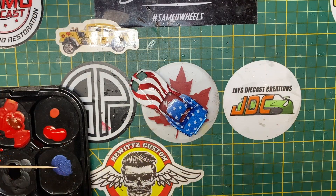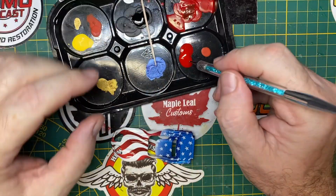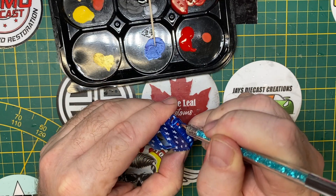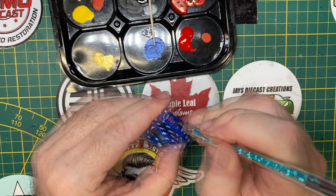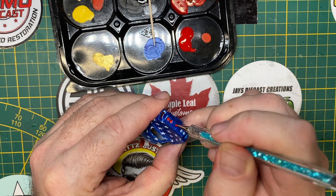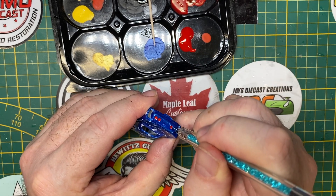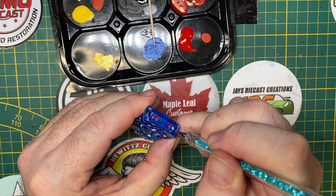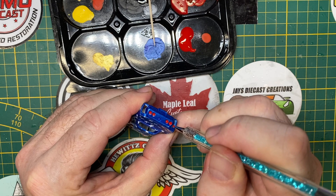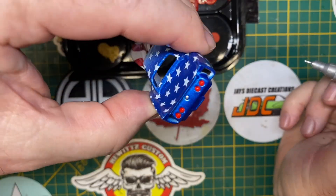This is a ladies fingernail decorating tool. Now and then I put on a hat and sunglasses and go down the beauty aisle and fill up a bag, because this is the perfect tool for this kind of application. The Corvette tail lights are round and they're indented in the back of the car, so you can't really make a mistake. You get a dab of paint, touch it in there, be careful, and you're going to get a perfectly round fill — and the trunk lock as well.